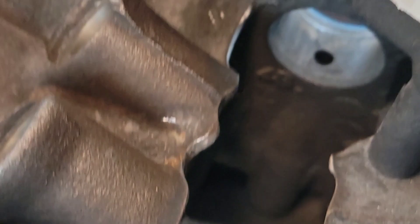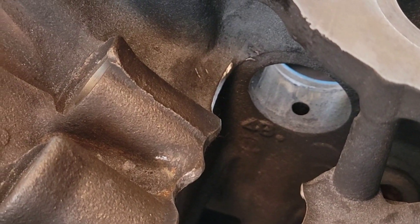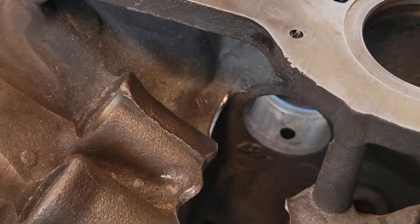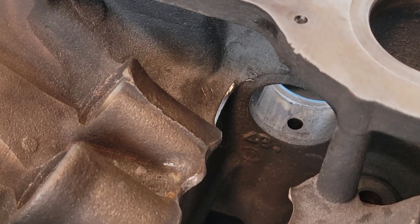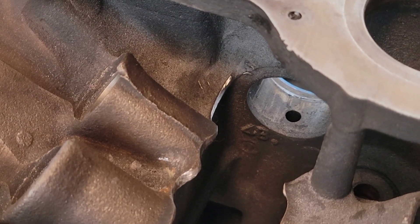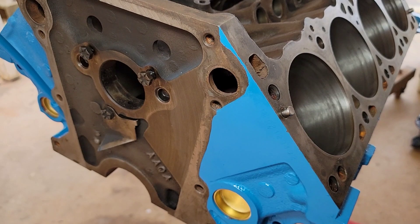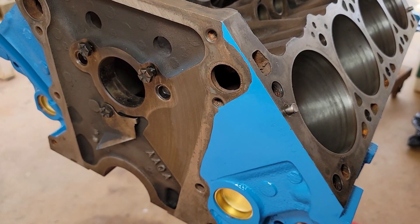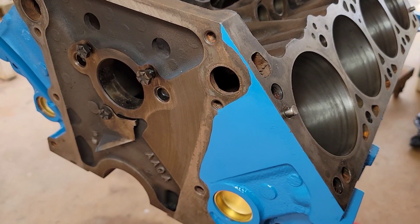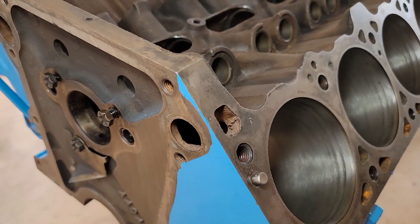I did get back there near that last lifter and dropped the floor on that side too, just a little bit, to help the oil get back to the pump quicker. But yeah guys, that's going to do it for this short video. Y'all stick around, don't forget to like, comment, share, and subscribe. I'm going to get back on this 318 budget build — see y'all in the next one.